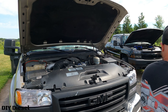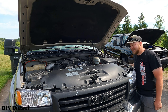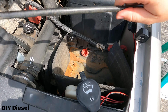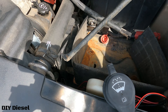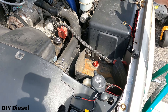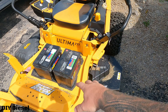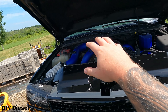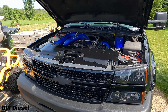Short guy, unlifted truck problems — don't judge me. We took this brace off right here to be able to get the other battery out. It's held on with two 10 millimeter screws, one right here and one over here. Just set it aside and take the other battery out. Now we've got both batteries out.